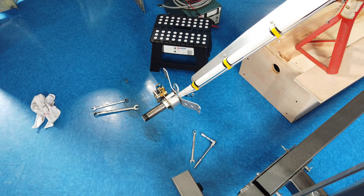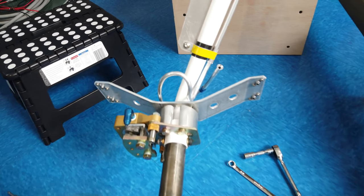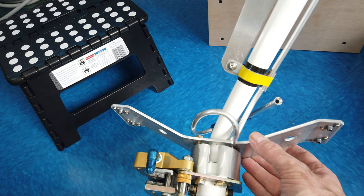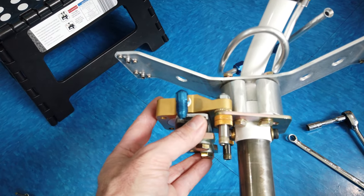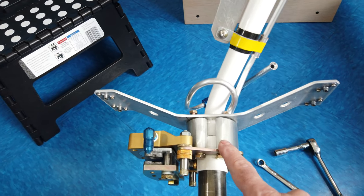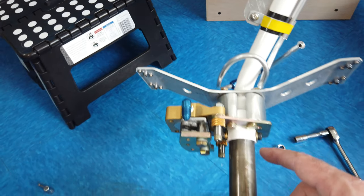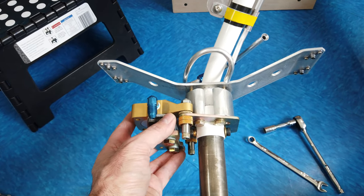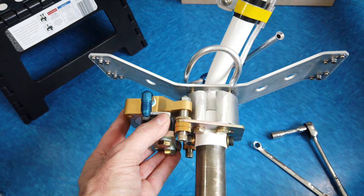Here we are actually on the airplane. You cannot bolt this aft or inside bracket to this assembly, because if you have this bolted together you cannot get your caliper in place. You can have the bracket attached to the sub-assembly very, very loosely — have the bolts almost completely out. You can slide this whole assembly onto the axle, leave it nice and loose, and then you'll be able to fit your brake caliper in place. Check that your brake caliper slides nice and free.